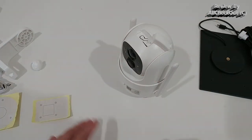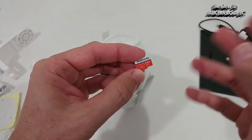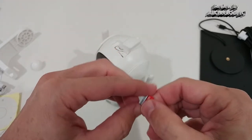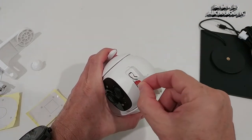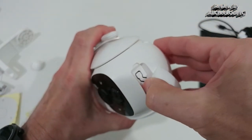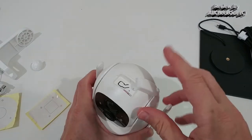I'm using a 32GB Samsung micro SD card. I highly recommend using a good Class 10 brand-name card to prevent any problems. You push it in with the pins going to the back and the writing to the front, then push it down until it snaps in. You can easily release it by pushing down again — easy to add, easy to retrieve.